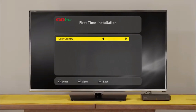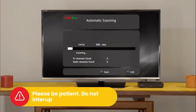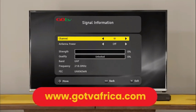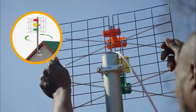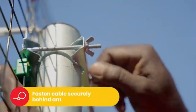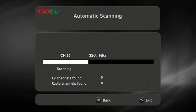Select your language preference and the country you are in. Next, on the active antenna menu, select Power Off. The screen will change to automatic scanning. It will take approximately 6 minutes to scan available channels. Please be patient and do not interrupt the process. If no signal is found, it will automatically take you to the signal detection screen. Insert the channel number for your region — this can be obtained from the GoTV website. At this point, you may need to rotate the antenna to maximize signal strength and quality. Use the on-screen bar to help fine-tune. Once you've optimized the signal, firmly tighten the antenna into position. Now, do a full-service scan so that the decoder can update and save the full-service list.